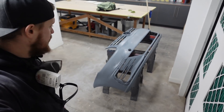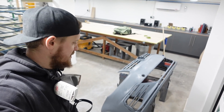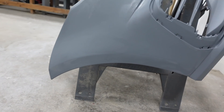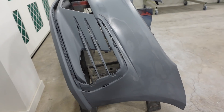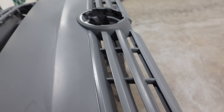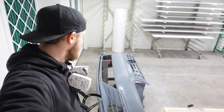There's that bumper all in primer. It looks a hell of a lot better now it's all in one colour. It does need a bit of work still — I did expect that. It's difficult when you've done the amount of sanding we have with just filler on to see every little imperfection, but as soon as you lay primer on it shows them up. Managed to keep the arch line on the end. It needs a bit of filler work down here, it's not quite right where I've prepped the plastics, but not a problem. The mottling should go as the primer dries — it's just different surfaces drying at different rates. The grill got primed as well, but again it's all faired up. Once it's gone off we'll nib it all down, sand from 400 grit, get it nice and smooth, and hopefully it'll look all right.